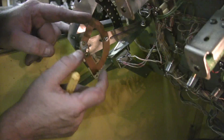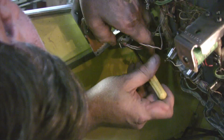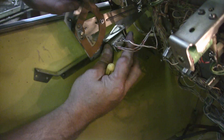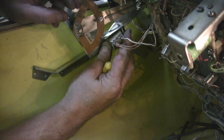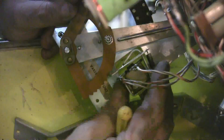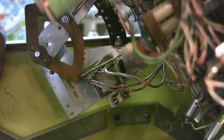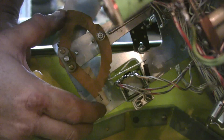Look, you count how many setups — they have the right grooves in it. You line up the little piece simply by loosening these two screws. The relay is loose, so to do it right, you move it all the way up and move the relay until it catches it just right on the last set. Watch: first stab on the first set of contact, second, third, fourth, fifth, sixth, and reset. That's all it is — it's as simple as can be to adjust that. A child could do it.